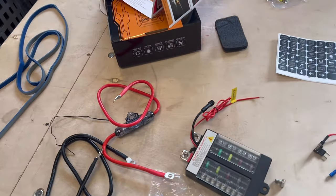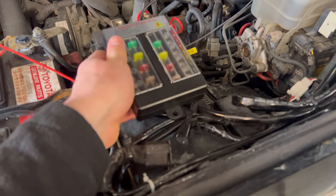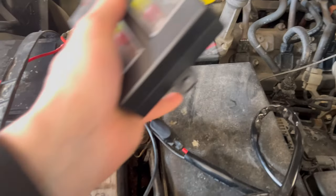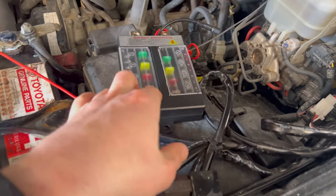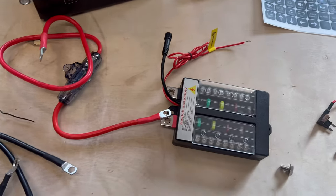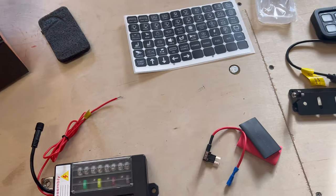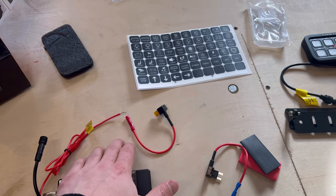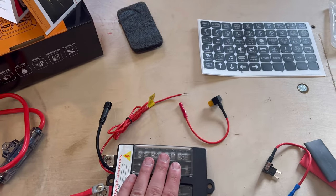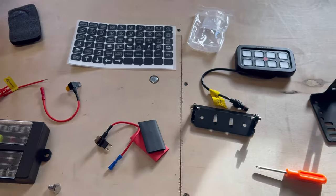First thing — I'm figuring out how to wire this in. This is probably going to sit on top of my fuse box in the engine bay, which gives easy access to all the wires, is close to the battery, and is out of the way. I'm thinking about making a plastic bracket, but I might just drill it straight in — checking for clearance first. Then of course we have positive to battery, negative to battery. We also have a little master power switch cable that goes to accessory power, probably piggybacking on a fuse in the driver's side fuse box so it only stays on when the key is in the accessory position — keeps you from draining your battery.